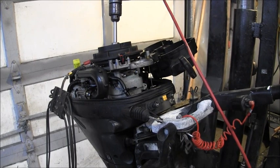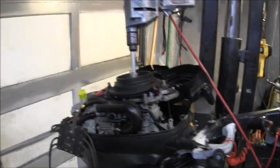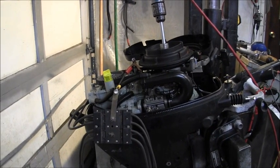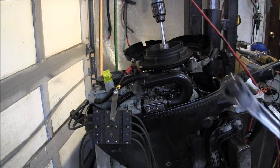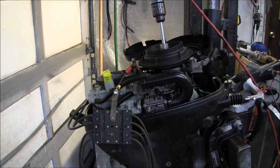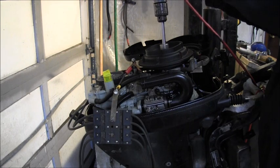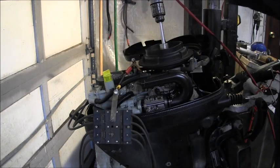Well, I pulled out the spark plugs. It was not hydrolock, but it was stuck. So I went ahead and put my Sparky Spider on there, and it wasn't stuck bad. So I just spun it over with a little 3/8 inch ratchet, and it wasn't stuck real bad. And then I sprayed a little Tri-Flow in the cylinder. Watch right in here. I got the Sparky Spider hooked up. Heck, are you in there? Yeah. These top two.